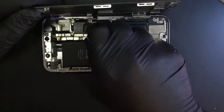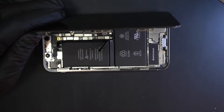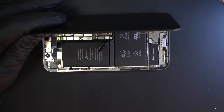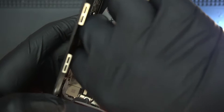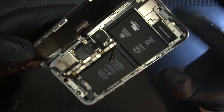So maybe it could be the battery itself, so I am going to try to turn it on from the power supply — sometimes it could be as simple as that. I am seeing that the phone is booting normally, we have our Apple logo, but it keeps rebooting. So we have now removed the possibility that it could be the flex cable, the battery, or the cameras.